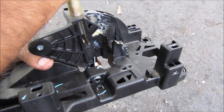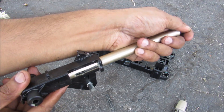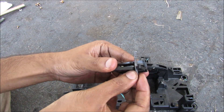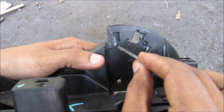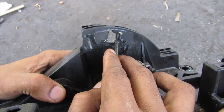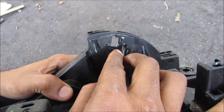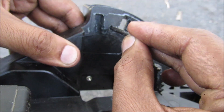At the bottom here we have the groove pin that's spring loaded. If I remove the groove pin I can release the spring from the shift lever. This groove pin is actually the key to how this whole shift lock mechanism works. On one side it engages with this black piece that will engage the shift lock mechanism and lock you into park. On the other side it will engage this teeth profile over here. The profile of these teeth determines whether you need to hit the shift button on the lever or not when shifting from gear to gear. For example, if I'm in drive and need to downshift to second, I need to hit the shift lever button to bring the groove pin down and go across into second. From drive I don't need to hit the button to coast into neutral. Finally, to get into reverse I'll have to hit the shift button again, and then once more to get into park.